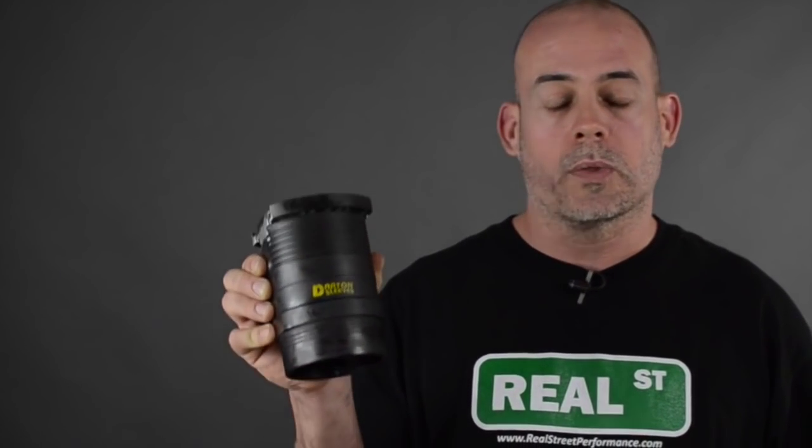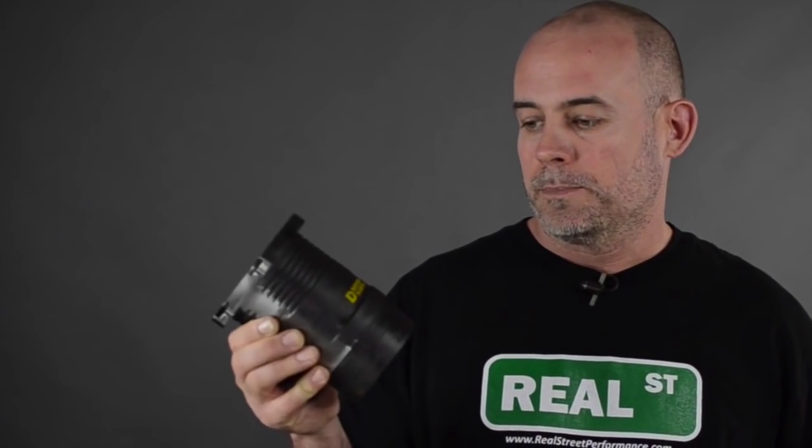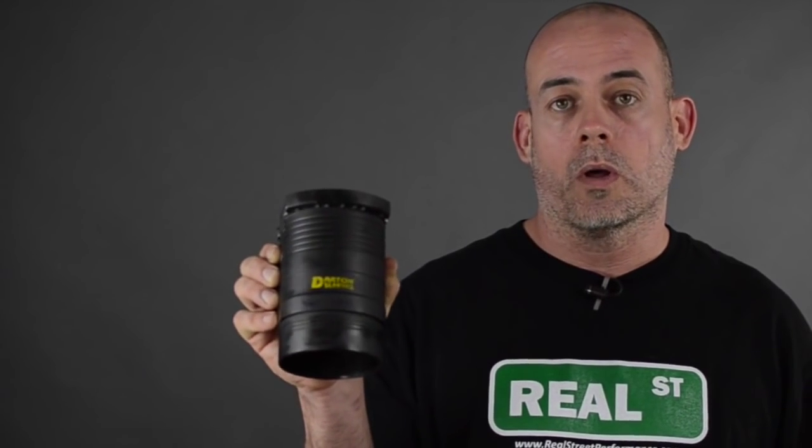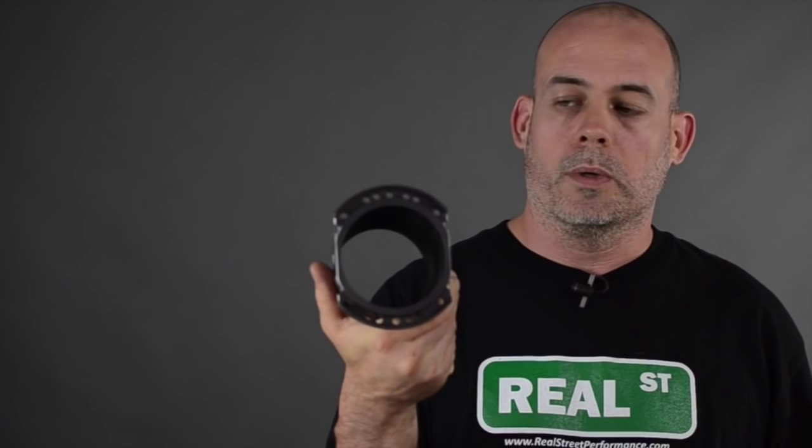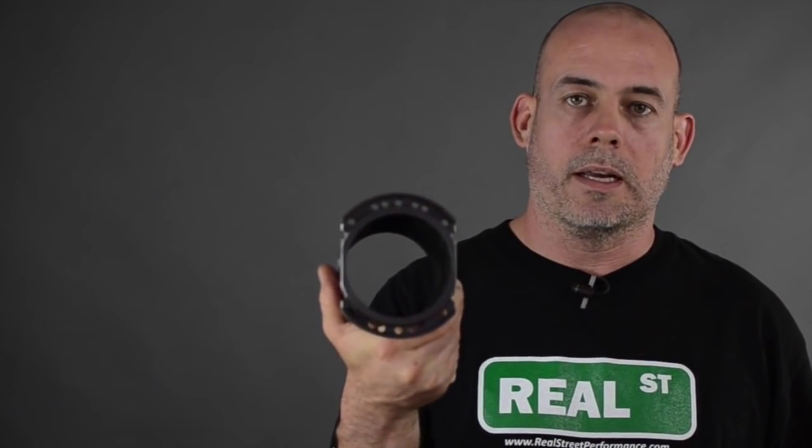The other thing is when you bolt the head on this, it's kind of floating in those O-rings. There's nothing that's unnaturally loaded in the block, so you have less tendency to develop cracks. This is not a new design. They've been doing this in the diesel community for a long, long time. You would just pull the sleeve out when it's reached its service life and put another sleeve in. It also locates on the other cylinders in the block, which offers some rigidity in the deck area.